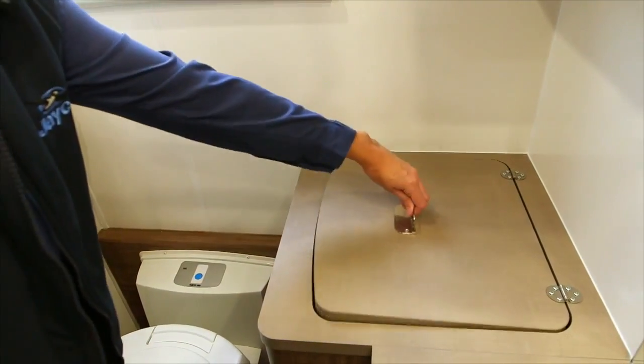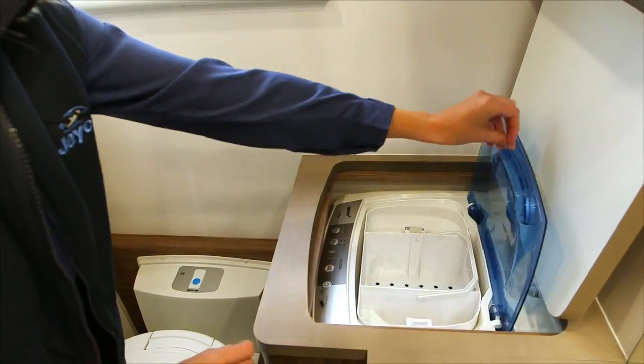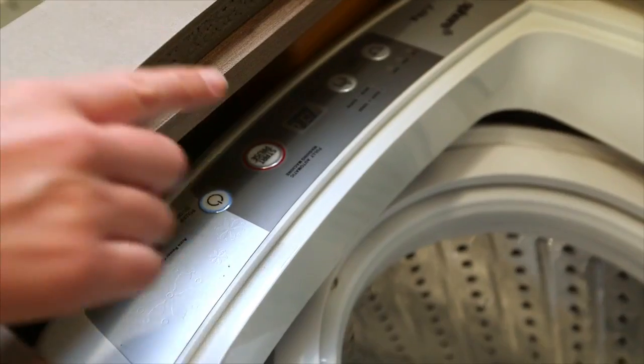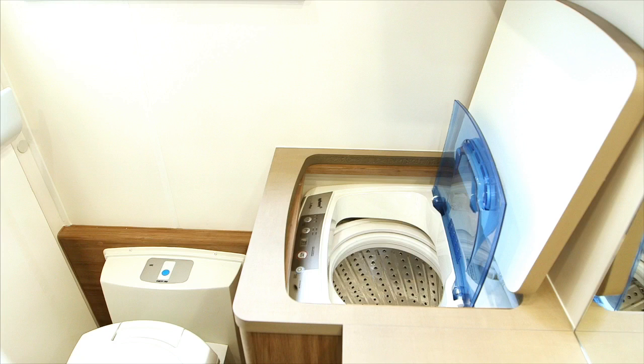The Sphere 3 kilogram washing machine has 5 processes, from a wash-rinse spin cycle lasting approximately 38 minutes to a simple spin cycle lasting approximately 7 minutes. Wash settings are set via the control panel. To wash clothes, select the proper water level according to the quantity of clothes. Select the programs and process. Close the lid and press the Start Pause button. For more information, refer to your washing machine operation manual.